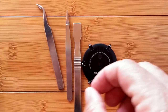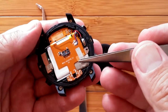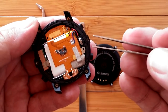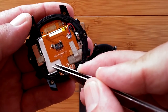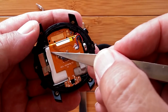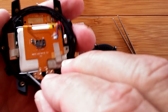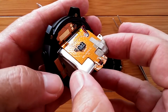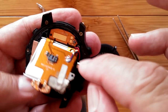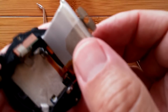One of the first things I always try to tell you guys is: if your watch gets into a problem where it's frozen, hung, or boot-looping — meaning it reboots and keeps trying to boot but can't go any further — one of the most common things you can do to try to fix it is simply disconnect the battery from the watch. Easier said than done on this one. On many of them, as you've seen, there's a little connector in the back and you just pop it up, leave it for a couple of seconds, and then press it back down again. What we're trying to do is lift this whole battery unit up.